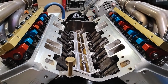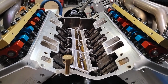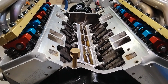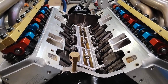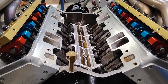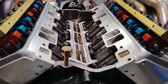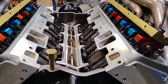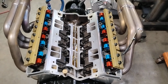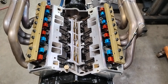So if you use the vice grip, just go through and tighten them all down, turn the engine, tighten them down, turn the engine, tighten them down. I've done that, but on one engine, just to try it, I ended up with a couple loose rockers, so I just go back to what I know, the old exhaust open, intake close method, EOIC. That's the timeless method. It works. You just go one cylinder at a time.